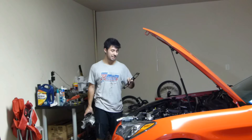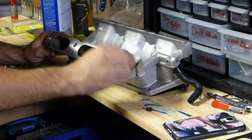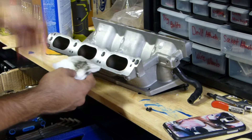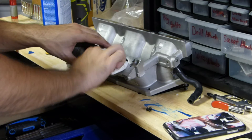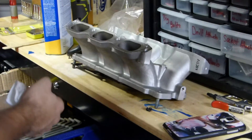So these are the original factory gaskets, and chances are after not only three years but unbolting and re-bolting these on multiple times on these single-use crush gaskets, that's probably what the issue is. So here we go. Judging by that, this is before we installed the catch cans. I installed the catch cans and I didn't clean this since then, but if this is the amount of oil that's going through here prior to catch cans, then chances are that's probably what's leaking. If the oil can get through there, chances are the boost is getting through there. So I'm going to keep cleaning these up.